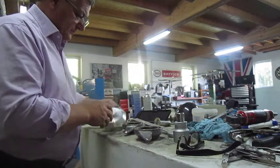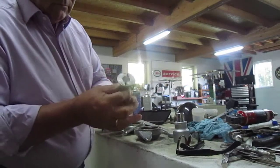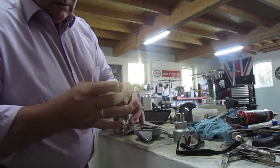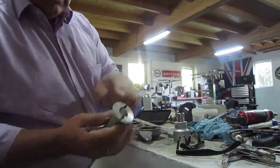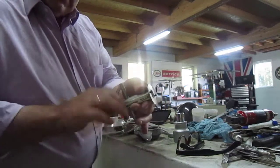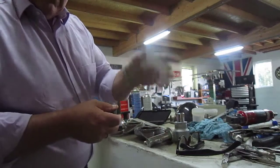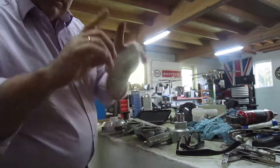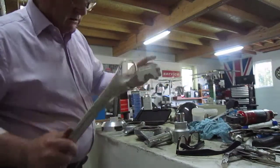The other thing I didn't show the other day was the top timing chain tool. This is basically the tool for the adjustment of the top timing chain. You've got these two that go into a housing, into pre-drilled holes. What this flange is doing here is actually pressing the detent in for you to adjust it, and it's anti-clockwise. And then this is your cam tool for lining the cams up to make sure that the cam lobe is in the correct position for when you're setting it up to the timing gear and so on. That's why I bought this some years ago — I wanted to set up the engine.